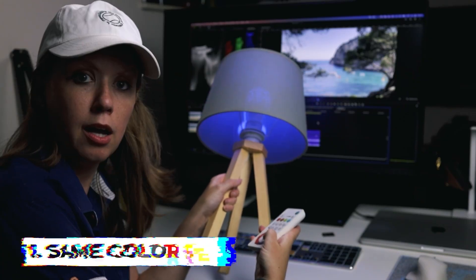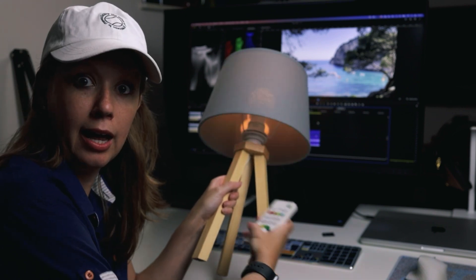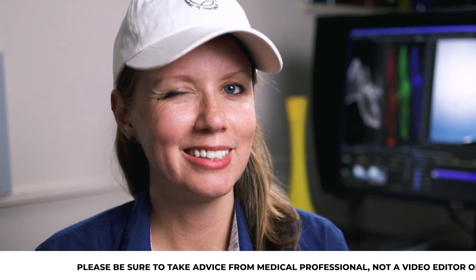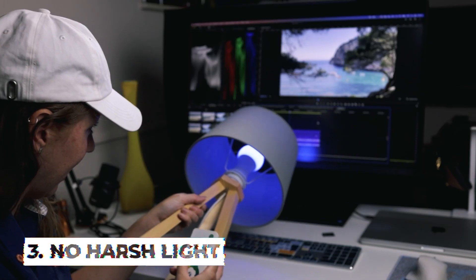Here are a few tips to improve the color calibration process. Tip one: make sure not to have multiple different color-temperature lights around the color calibrator while it's trying to calibrate — it will just confuse it. Second: be in a darker room — you don't want too many lights around your monitor. Number three: avoid shining a light directly at your monitor. And number four: a detachable hood — if you have one, it can be on or off and it doesn't affect the color calibration process.